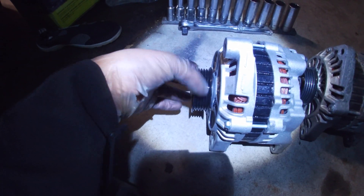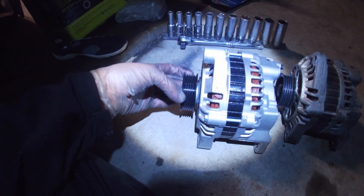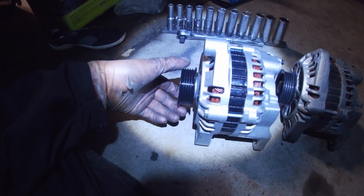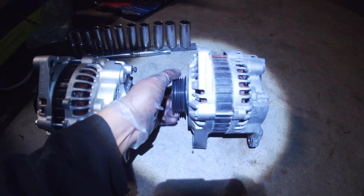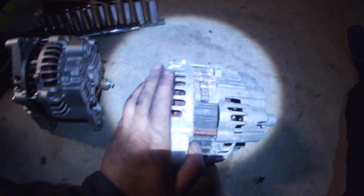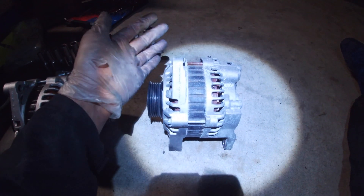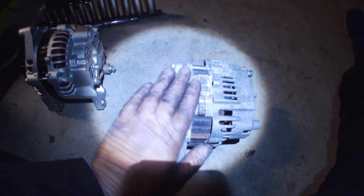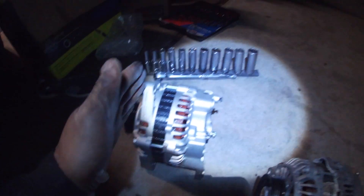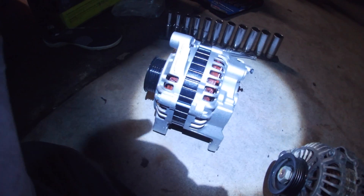That's about it — it's pretty simple. You just gotta get the angle grinder and cut it right here, or even a Sawzall, either one. Then it should all bolt back in properly. You do have to get another belt — I'll put the part number in the description if I remember. It's a little bit shorter belt. The reason why this one went bad: as you can see it's all corroded. What happened was my hood vent — I forgot to put a cover or tarp over it, so water poured down. About two months of me not driving it and it just getting soaked by the rain, so the aluminum all started to corrode.